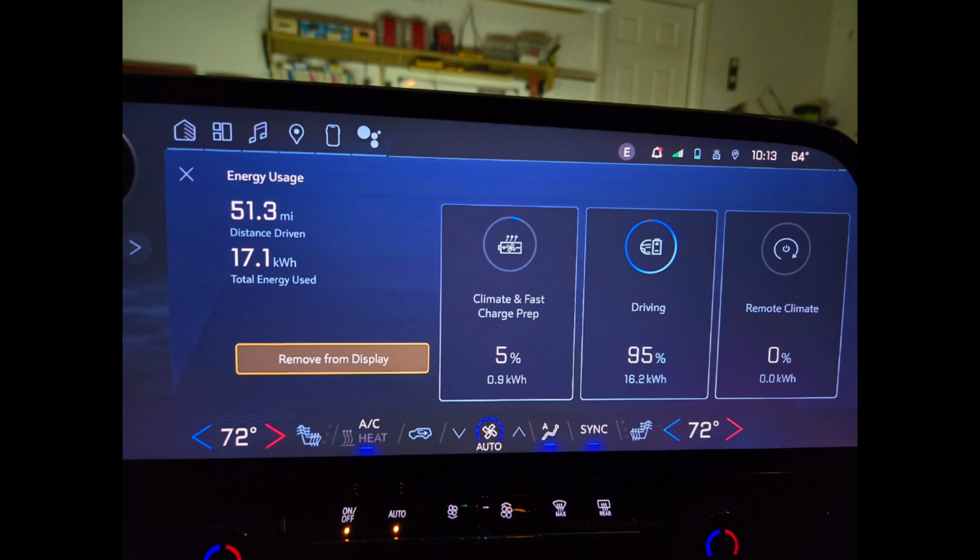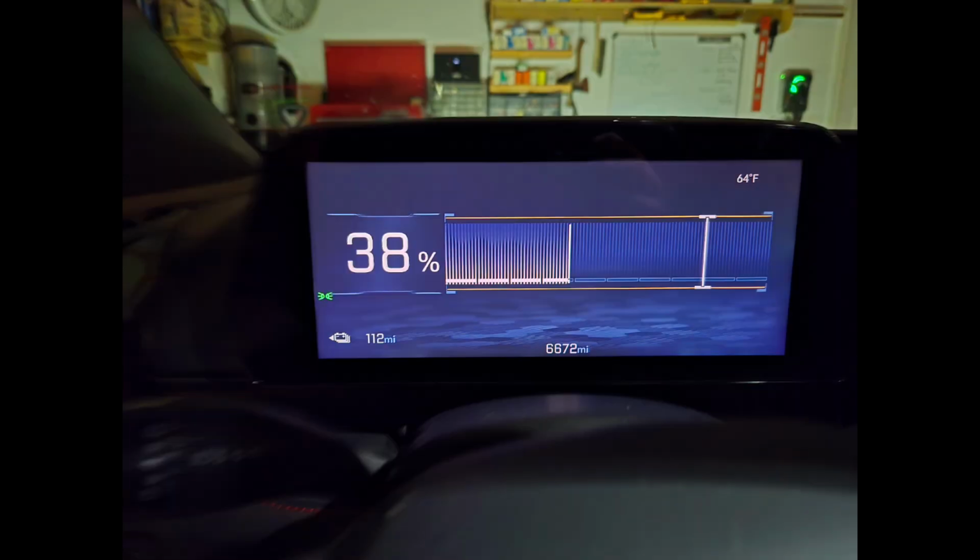But this actually matches, showing 35% of the battery would be about 33 kilowatt hours, which makes sense when I looked at how much it charged. If I take about 10% off of 36 kilowatt hours that I charged in 15 minutes, and 35% for the 15-minute 10% challenge, that would also agree with the 95 kilowatt hour usable battery capacity. So I'll do some more testing on that, try to do a full discharge to 0 and back, so we can see what that is. That makes more sense on how much range the vehicle has, though. So that's interesting to me.